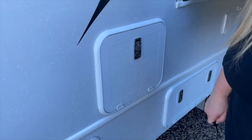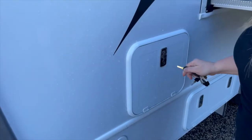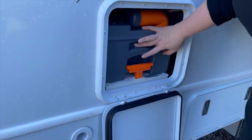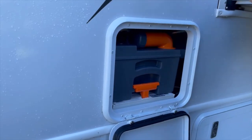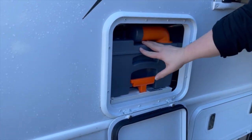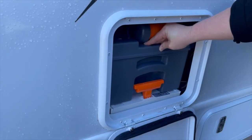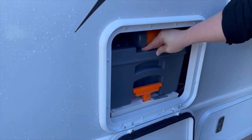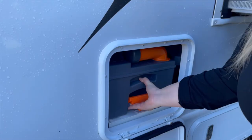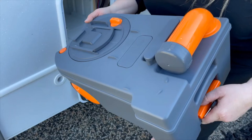Now we're outside and we're going to go through the procedure with the toilet cassette. You'll find it on this hatch — it's the same key that opens the other hatches. Put it in, turn, pull and rotate, and pull the flap. This is your toilet cassette. To remove it, make sure the blade or flap is closed before you pull it out. Also make sure everyone is aware that you are removing the cassette, then simply put your thumb on top and lift here to release and pull the cassette out.